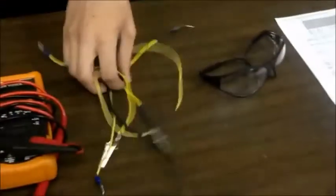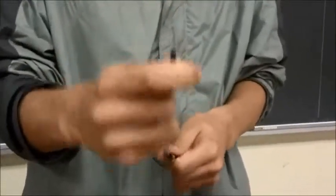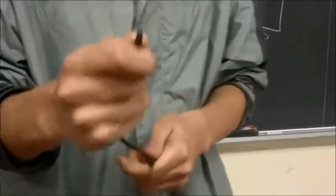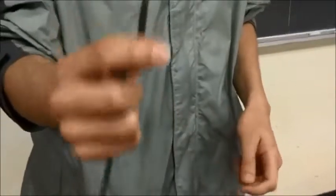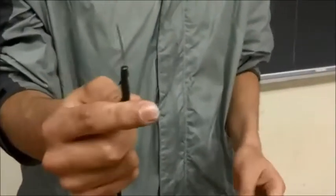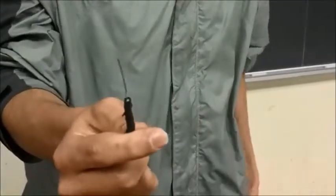The two types of jumper wires we'll be using are male and female. The female goes on the terminals on the relay, and the male has a probe end to go inside the fuse box terminals. This is so, in case you don't have a T-pin to use, you can use this. But if you prefer T-pins, you can get them at a hardware store. A T-pin, or probing end, is safer to use to prevent spreading the terminals inside the fuse box, causing an intermittent open problem for the relay.